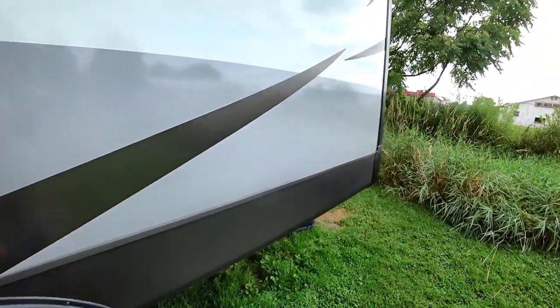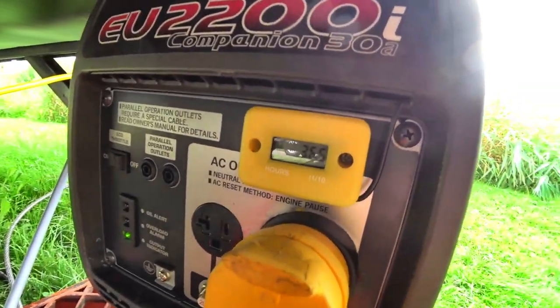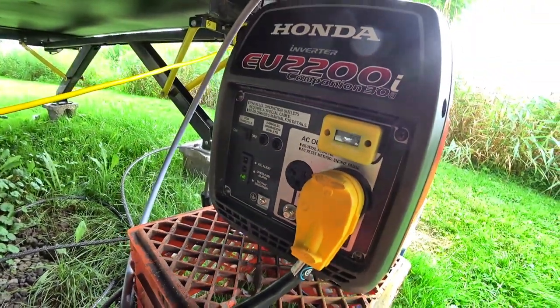Now let's talk about where you're going to mount and secure the generator. The best way is mounting it to the RV, but you've got to keep it protected from weather — it could be hot and raining. A lot of people try to throw it underneath the RV, but that's not a good idea because the fumes can stay underneath. In the middle of the night you might have a carbon monoxide alarm go off — or worse, you might not wake up. So you really don't want to trap your exhaust underneath your RV.